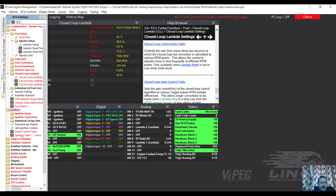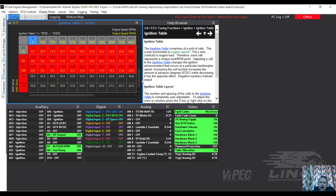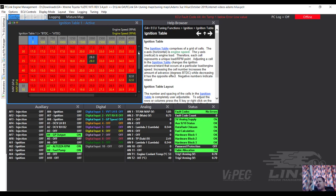Looking at the ignition table - these are kind of similar. I've got a bit more timing down low: in this area I've got 18 and 20, his is back at 14. So mine is a little bit more advanced. My tune was set up for 95 or 98 fuel - that's equivalent to US 93 octane - so we're pretty similar in fuels. If anything, mine being on 95 is a little bit more conservative. Josh's numbers are even further conservative and that can be a problem.